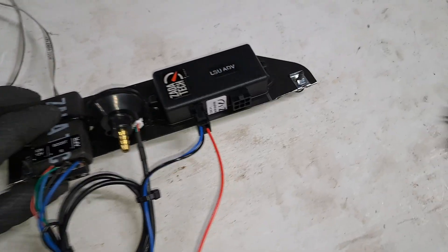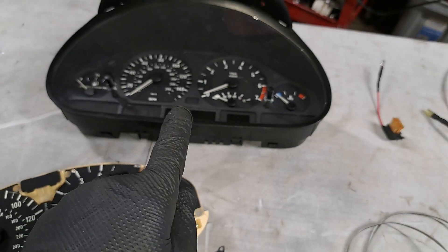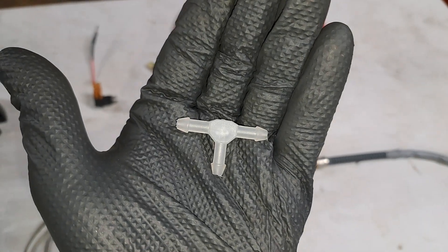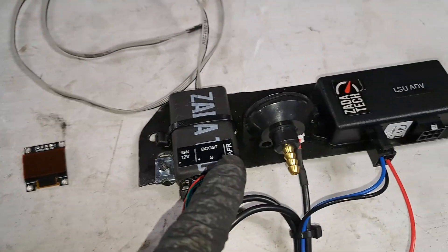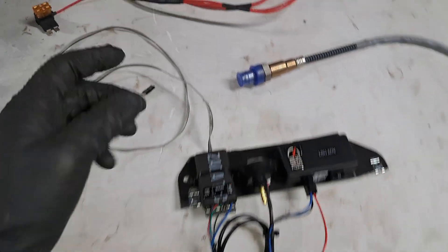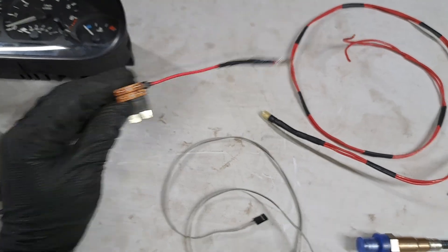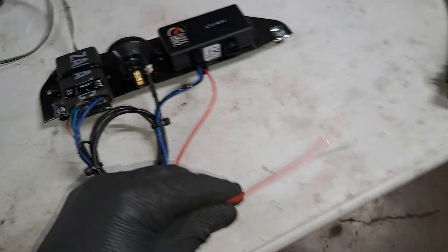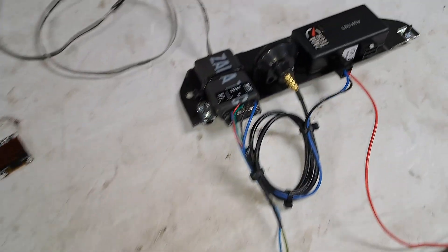These components are all attached to a bracket that I made — it keeps them more organized and will attach to the car with these Phillips fasteners. This right here is the display itself — a little miniature LED gauge that will fit directly into the gauge cluster. They also include this Bosch O2 sensor for the wideband, plus this vacuum tee in case you're splicing into an existing vacuum line, and a small filter to keep contamination out of the boost sensor. For power, I made my own little harness here which will get power from the fuse box with an add-a-fuse tap, connecting to the wideband controller and primary gauge controller. I also made a chassis ground harness to ground these controllers right to the chassis.